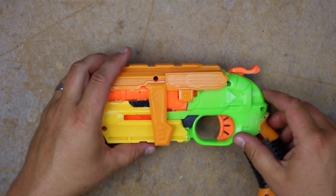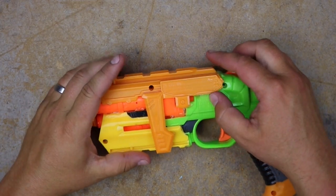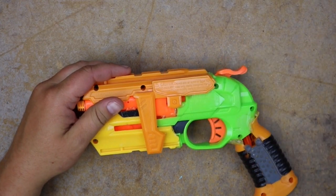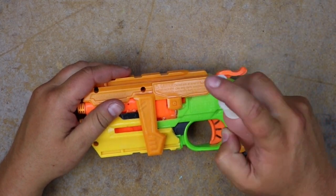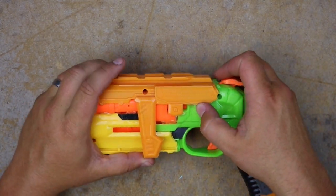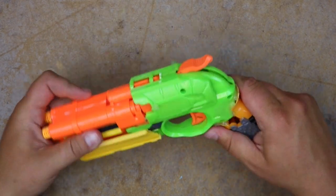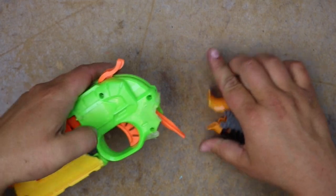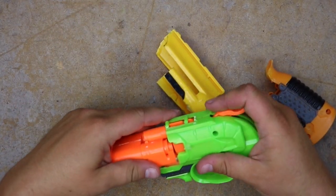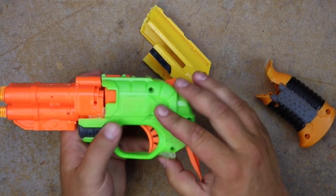I like using the alcohol method because hot glue will sit there and it'll stick and it'll be great, but then you have to peel it off and sometimes it leaves like a film of it on the plastic surface. I just took some rubbing alcohol in this little spritzer and you just spray it on there and it kind of soaks in a little bit. Then you can just easily separate all the components, and everybody just kind of slips apart fairly easily. The chunks that are left usually just pop off easily as well.